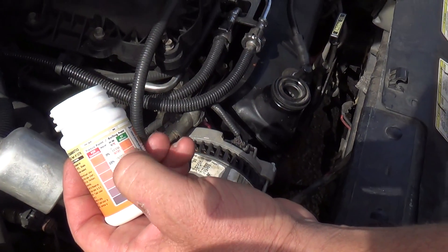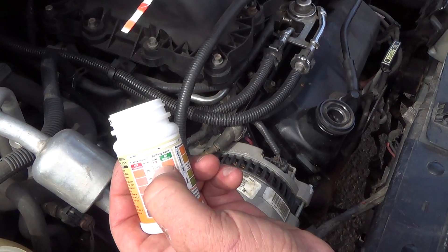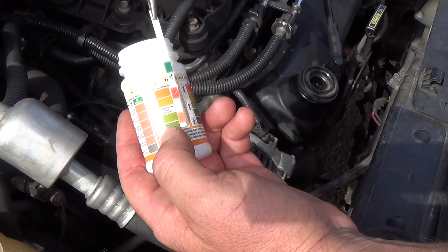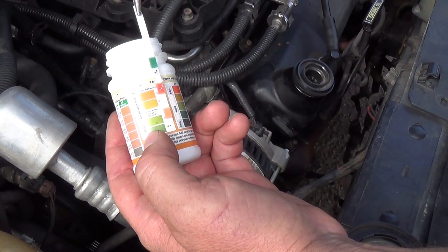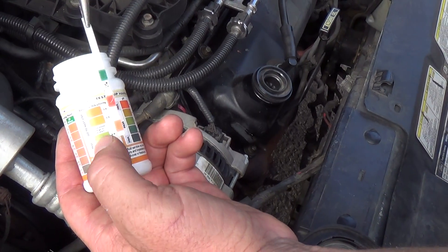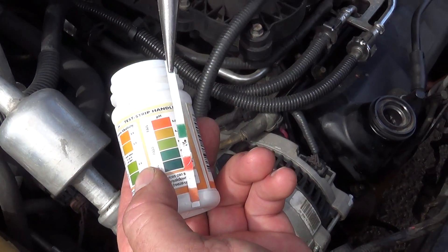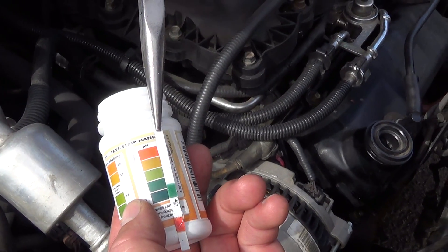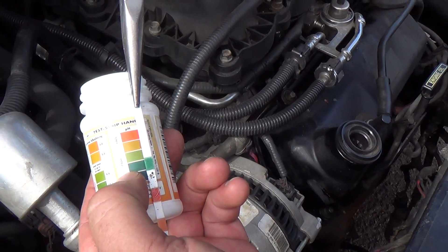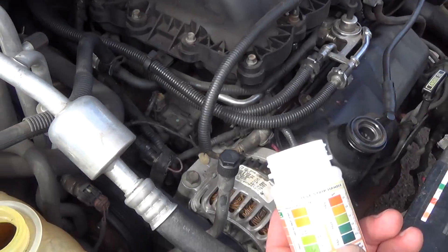You can change the freeze and boiling point by changing the ratio of coolant to water. In San Diego it should be 50% water and 50% coolant, which puts you right about here. Checking alkalinity, I'm on the high side, so I move to the next step and check the pH level — my coolant still passes but it's getting very close to the fail threshold.